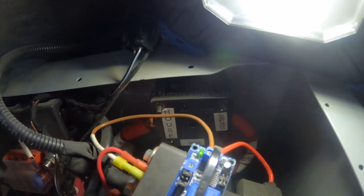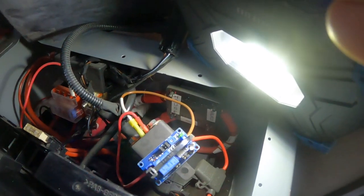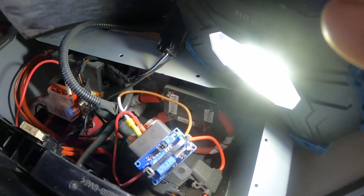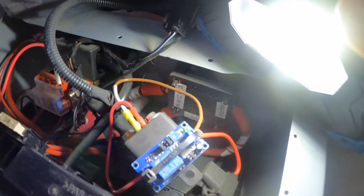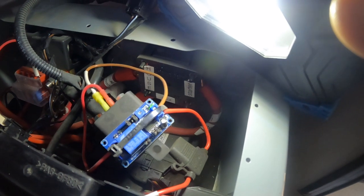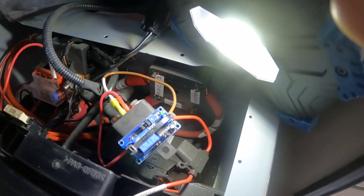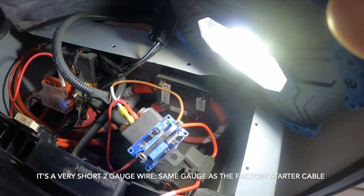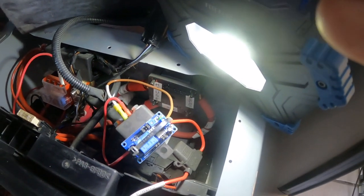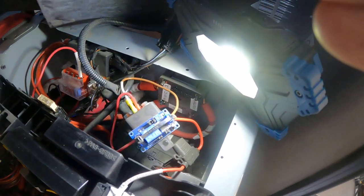Typically when I start the vehicle, after about a minute the time delay triggers and the starter and auxiliary batteries get charged up and synchronized in voltage before connecting to the house battery bank — which is a much bigger battery. If I had an electrical problem I could take away the house battery and run off the auxiliary, or interconnect any combination through this battery switch. I essentially have three battery systems, and any of the three can be used to charge the starter battery or start the vehicle.